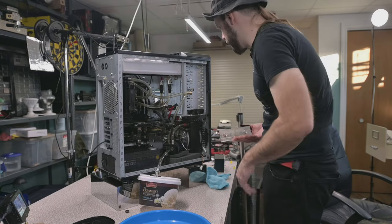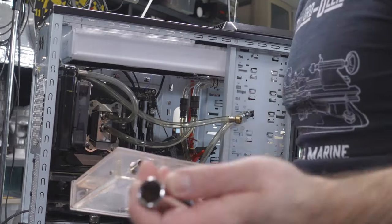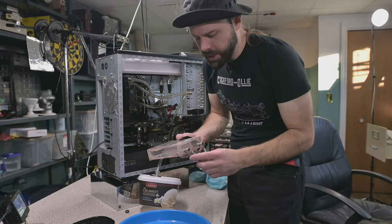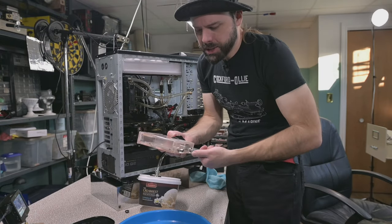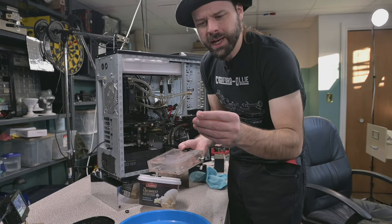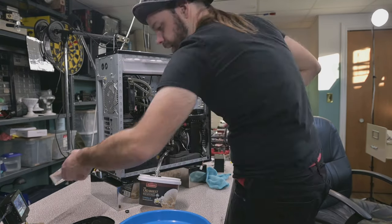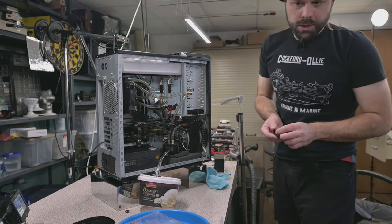Lit or GTFO, right? Another pro tip, that's a 5/8 socket, just a 5/8 socket. And I keep this kicking around because it is great for hand tightening on these guys. Most fittings that I find that have the bolt pattern on them take a 5/8 socket. Okay, this guy's dripping, straight dripping, bud.